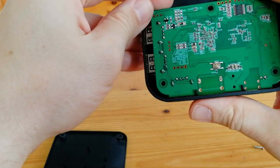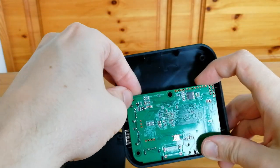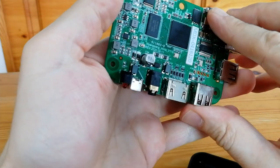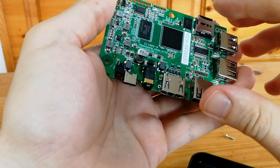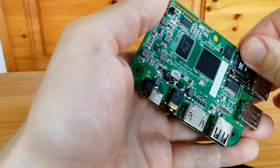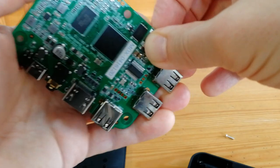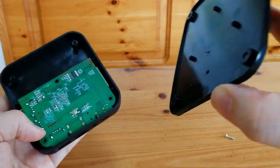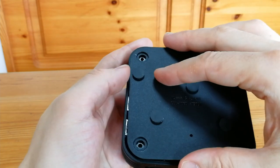This circuit board is actually held in by the bottom of the case, so all we need to do is pull it towards us and we can take it out. The MicroSD is in the same holder as earlier — push towards the hinge and pull open. Take note: when you're putting this back together, the switch lines up with a hole at the bottom of the case.